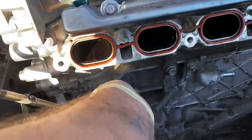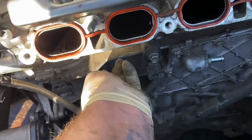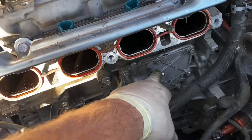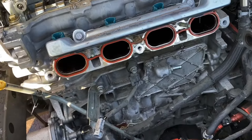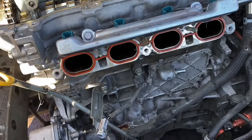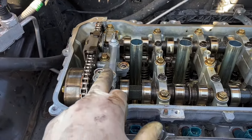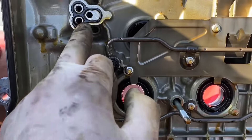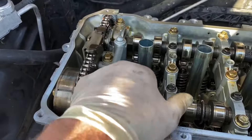Don't forget the 12 right here for the oil dipstick tube. Next is going to be the intake — number one thing: do not forget to hook the PCV back up. It's so much easier before you bolt it on; otherwise the engine will start but it'll stall a bunch of times. Time for the valve cover — be careful not to lose the rubber that belongs on these two pieces. Make sure you don't lose them, otherwise it won't run right.